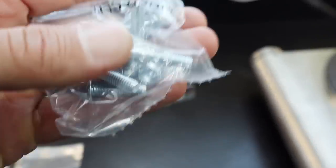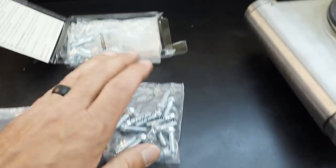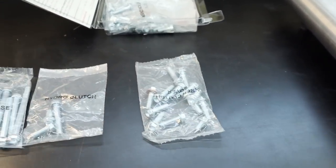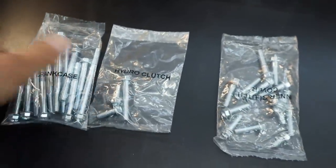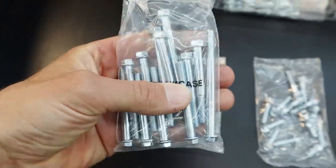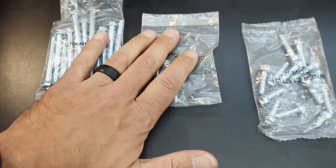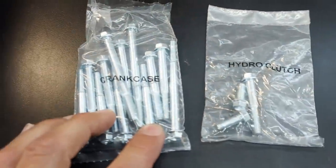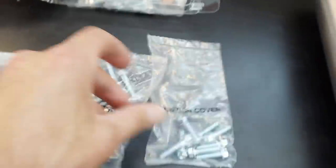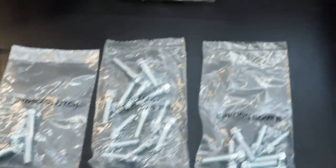Of course, it is the dished head bolts that I love. They look sort of like a tie, but they have a nice bright coat of zinc. And for you guys who have been following along so far, this is the color, or I guess shine or brilliance, that I've been chasing with all of the chassis hardware that is normally that ugly KTM gray. So in order to get those bolts to match Dave's bolts, I've been stripping, vapor blasting, and zinc plating all that stuff. So everything is going to be very cohesive, very bright, very good looking when this bike is done. But you already knew that.